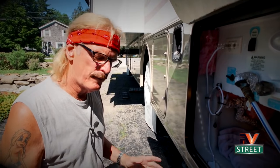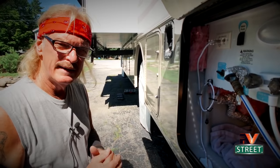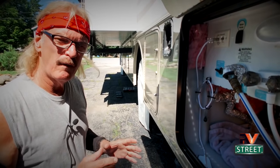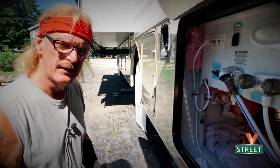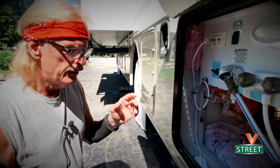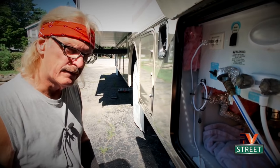Okay, let's get right to it. Our water pump is located in the wet bay. So let's go to the wet bay and we'll pick it up from there. Okay, so here we are at the wet bay. Replacing a water pump really is quite easy. It runs on 12 volt, so you don't have a lot of high voltage here and you don't have to worry about disconnecting from the pedestal and all those kinds of things.